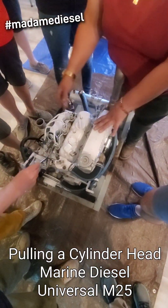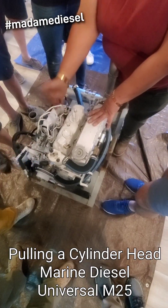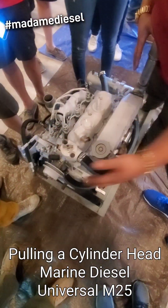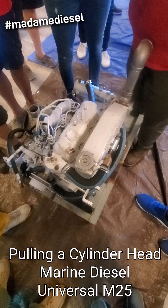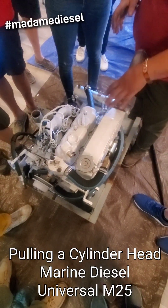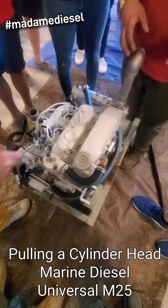So if I know I'm pulling your cylinder head, I'm going to pull things like the intake, the fuel lines, I will pull the injectors out, I'll take the manifold, the thermostat housing, the exhaust elbow. Keep all the gaskets, try to save the gaskets if you can — they're all new. I would like to run this engine down the road, so let me know when you're ready to pull the valve cover, and I'll tell you where to go next.